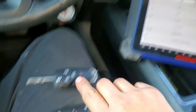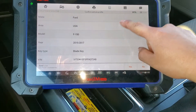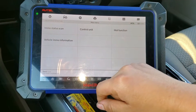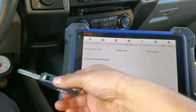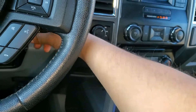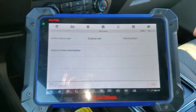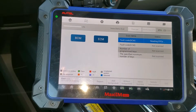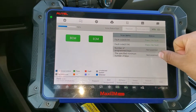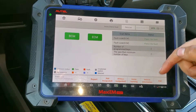To program these two keys, we're going to use the Autel 608. Here we have the truck's information already pre-selected. We'll need the original key to open the switch and we're going to scan the immobilizer to see how many keys are programmed, because you can only program up to eight — we should see about two or four already from the factory.